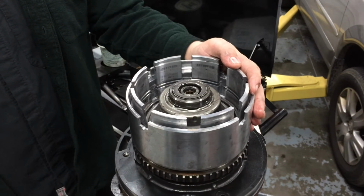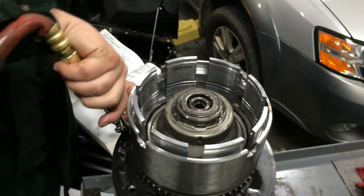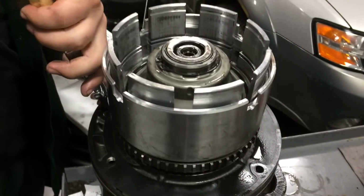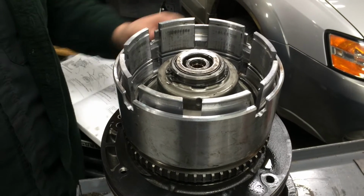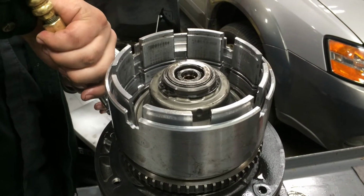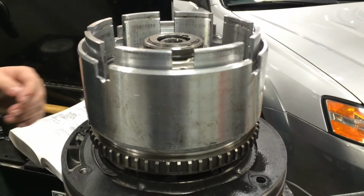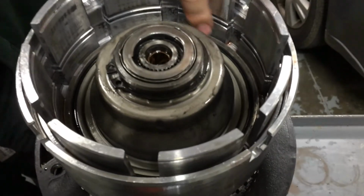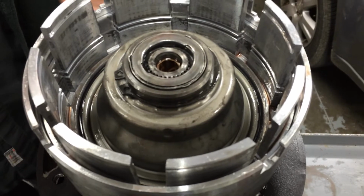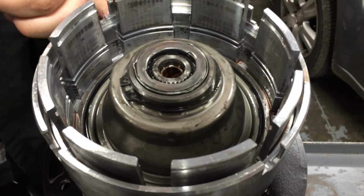That's ready for clutches. Okay, so now we're going to demonstrate all three piston applications on this input clutch assembly. First is the overdrive, where this is shoved down. And it seals quite well. Next is reverse, where the shell is forced up to engage the reverse clutches. Also seals very nice. Now this one can make a little bit of racket. It is the underdrive, which applies this lower piston up, but typically it will force the whole assembly to shoot up. You'll see what I mean.